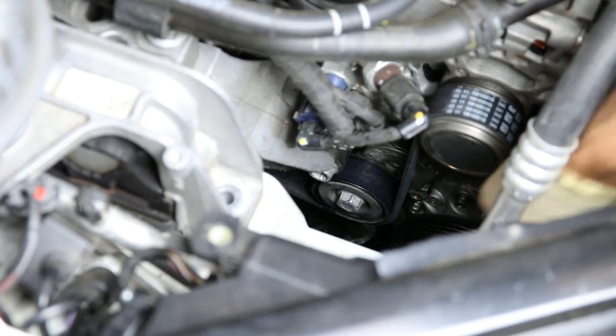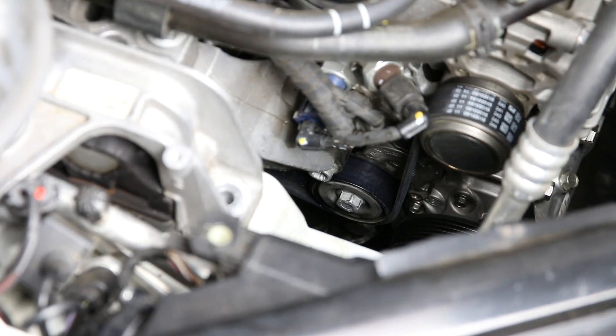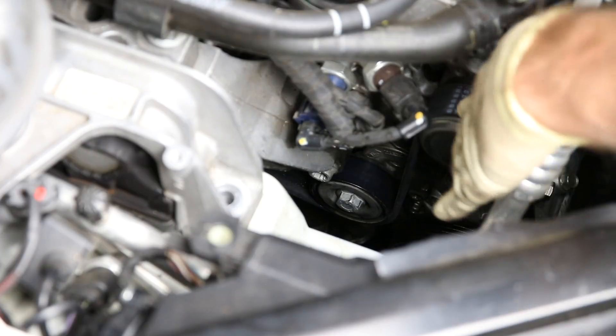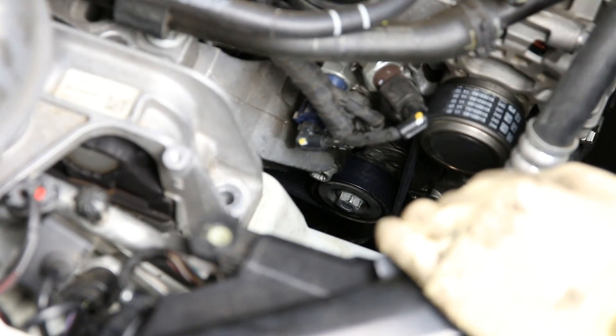And as you can see, we got it on there and we're all set. Normally you would reinstall your catch can and be finished. Before you start the car, make sure you eye the belt up — confirm it's lined up in all the grooves, because if it's not and you start it up you're going to throw the belt off and destroy a brand new belt. That's all set — thanks so much for watching our DIY on how to replace the serpentine belt on a Mark 7 GTI. Support for purchases of parts like this helps support videos like this one. If you liked this video, give it a thumbs up and subscribe for more.